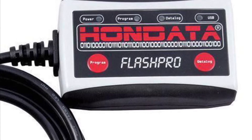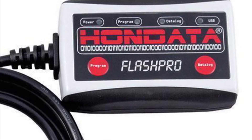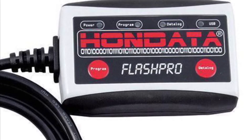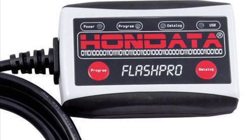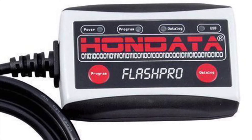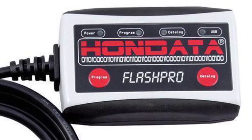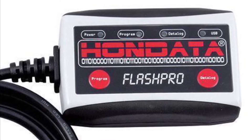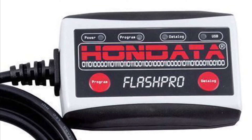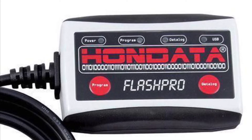When it came to flashing the car, they were both pretty much the same as far as how long it took — roughly around five minutes to just over five minutes. At the end of the flashing process, hondata is very easy: it just says turn off the car completely and then the screen will recognize it and pop an okay button. However, with the ktuner unit you had to turn the car off, wait a few seconds, put the car back into key-on ignition-off, and wait until the system recognized it on the laptop before pressing okay. Unfortunately, I had a lot of problems with that process.